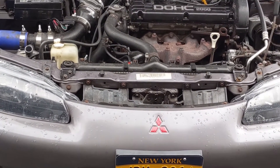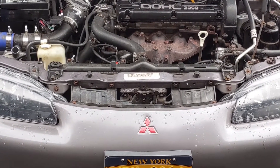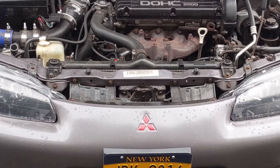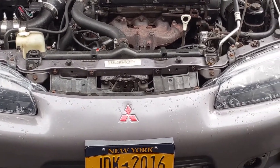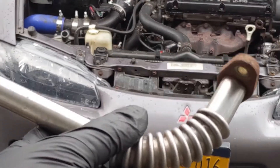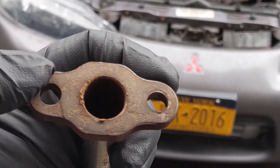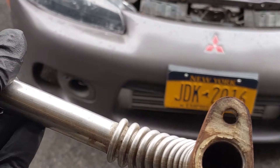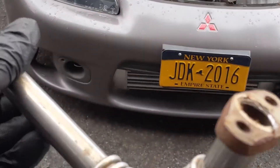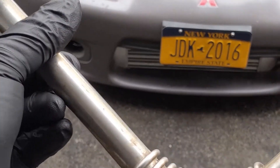I haven't had any issues other than this new leak that started at the pan where the oil drain meets the pan. A lot of guys make these or buy the kits - the rubber hose, oil-safe high-temp 5/8 lines - you can get them if you want. But I've got some spare parts from when I tore off the old turbo. I have this aluminum part sitting around, and I know it's the flange for the T25, but this part is too small so you have to modify the end. I don't want to spend money on the 1G-style oil return or one of those rubber hose adapter sets.